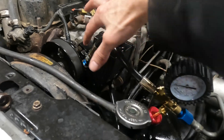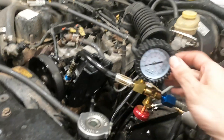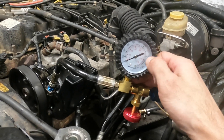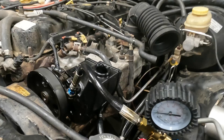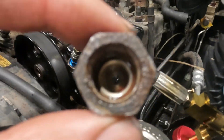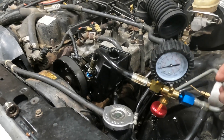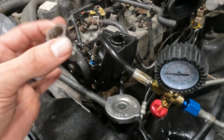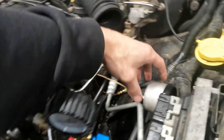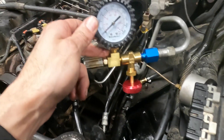All I did was swap the pressure relief valve. The WJ 4.7 pressure relief valve allowed this to go up to about 1700 PSI and steering felt a lot better. The only other modification you could make is to actually drill out this hole slightly, which would increase volume. This is where the science of my test hits a dead end because it's going to really boil down to feel. I guarantee it will give a little bit softer feel, but if you have too much volume, my return line pressure is going to be extremely high.